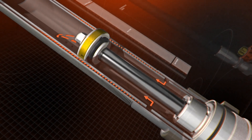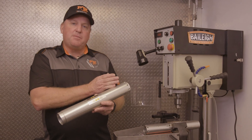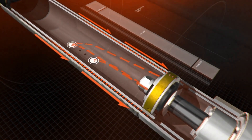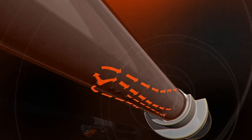The main piston will go up and down the center of the inner body that's inside of the shock absorber. The cool thing about the internal bypasses is as it's coming down through its stroke into what I call the ride zone, oil is bypassing the main piston, giving you a more comfortable ride because there's less resistance right here than at the bottom of the shock.